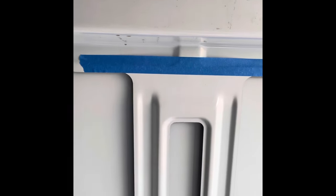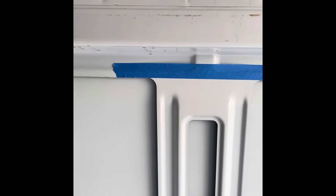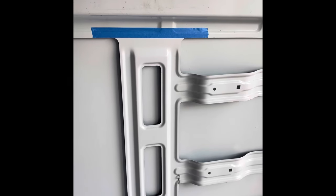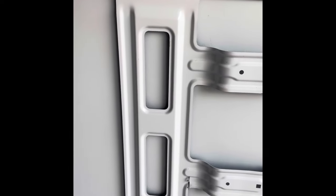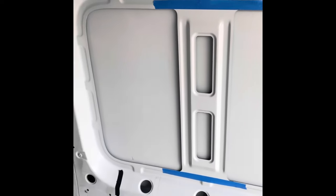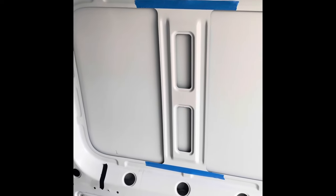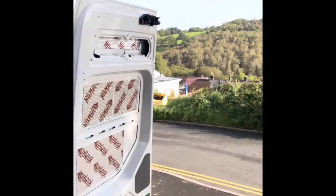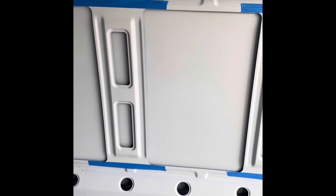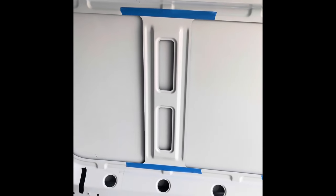This is just to give me a line to follow. It's much easier if you just do that with a line - you can follow it across and just cut these out. Much easier than using an angle grinder because there's a lot less cleaning up to do inside the vehicle. I've done that side there and I've marked this side up ready as well. I'm going to do one side at a time, just in case we have any issues with weather. It's nice and sunny at the moment but who knows it could change. So let's get on and get these cut out with the hand nibbler first.